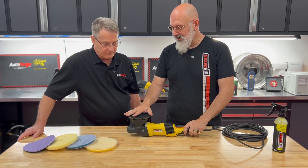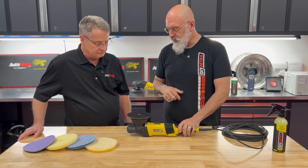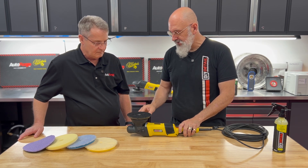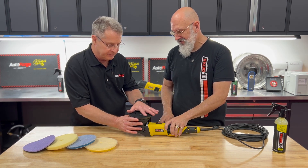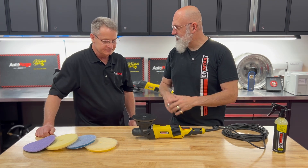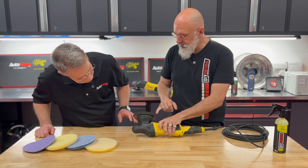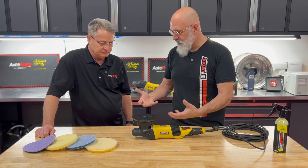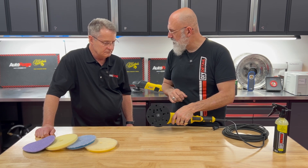The backing plate — we're showing it now with a 6-inch, but it also comes with a 5-inch, so it comes with both. It's a free-spinning machine, making pad cleaning easier and less chance of stalling. We always want to keep the pads cool when we're working. This backing plate looks like it's had some engineering going on with it — it's not just a solid piece of plastic. There are holes along the edge connected to slots, cross-drilled like your brake rotors — same idea. Basically it's expelling the heat from the pad. The motor cooling comes out through the bottom and also helps cool the whole system.